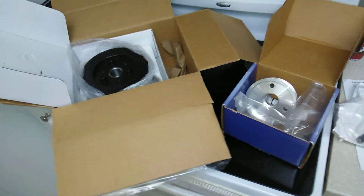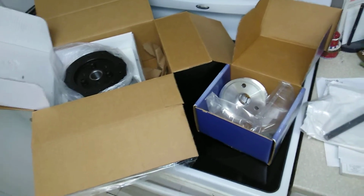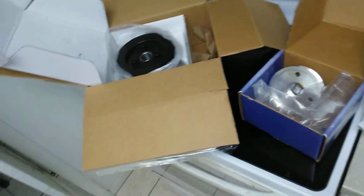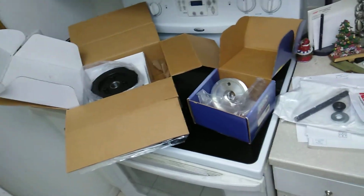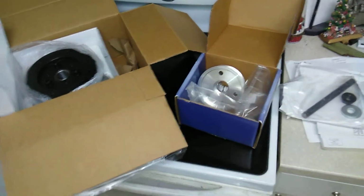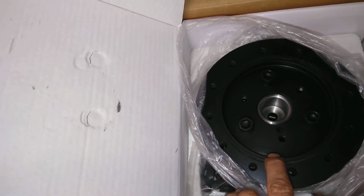When you pull the OptiSpark out, which I know now, hindsight's better than foresight, that seal automatically goes bad or starts leaking. So I put everything back together, the car cranks, and that second seal, I believe, is leaking. It's starting to have a little drip down the cover, and well, I've decided I'm doing it again, and that's inspection of everything. When I was looking for the leak on the old distributor, the plastic piece was coming apart.